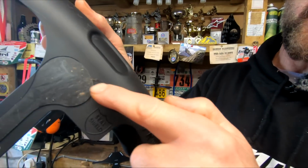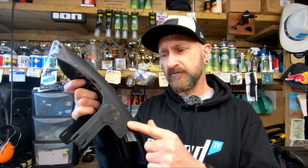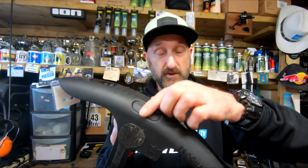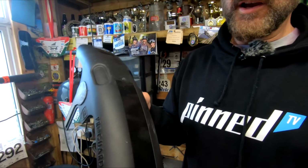You've got their sort of patented seal guard here. They've got this extra bit here. Basically that will protect the seals of your forks. Makes it so that when you're doing your seal changes, you don't need to do it as often. This bit here, these indents, they're basically to give it a bit more clearance when you're bottoming out those forks. It's a matte finish, that's the new finish on them, looks lovely, it's really nice to clean.